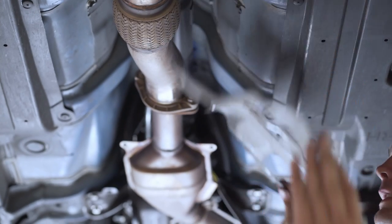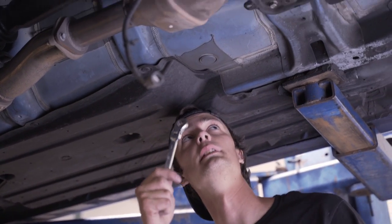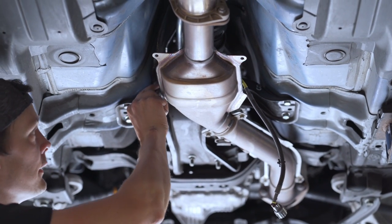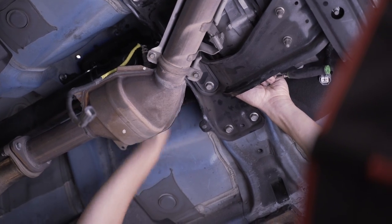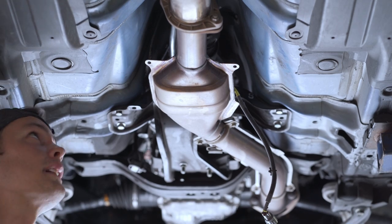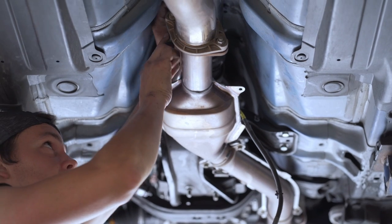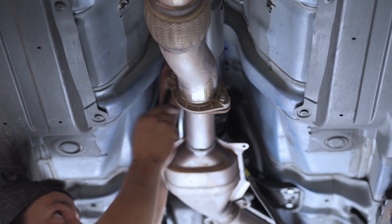Got the 14 millimeter now. Take this wrench and start loosening the 14 millimeter bolt going through the bottom of the shifter mount — back it all the way out and pull it. The top of this drops down. Come to the back of the shifter — there's a bushing at the bottom of the factory shifter assembly with two 12 millimeter bolts going right into the chassis of the car. Remove both of those.